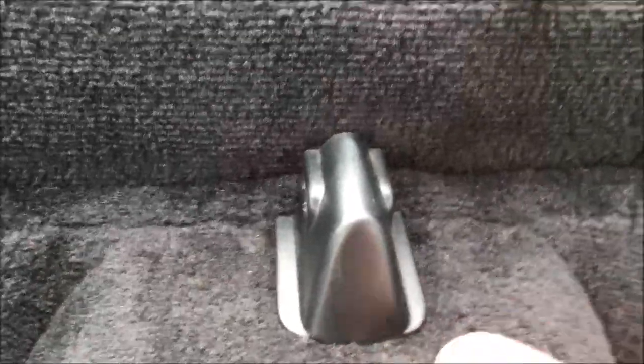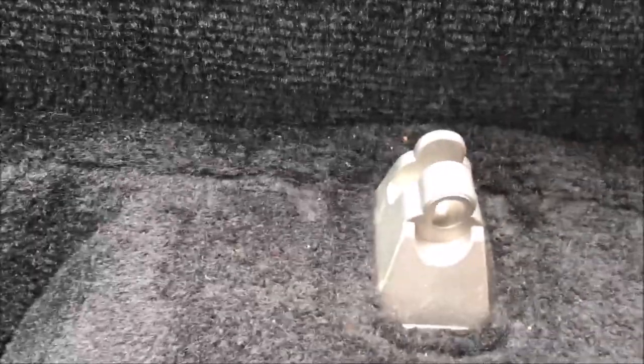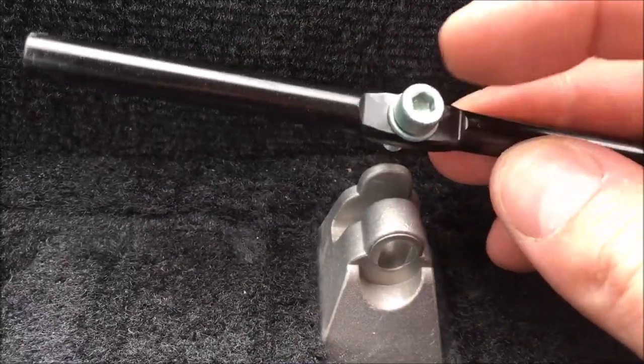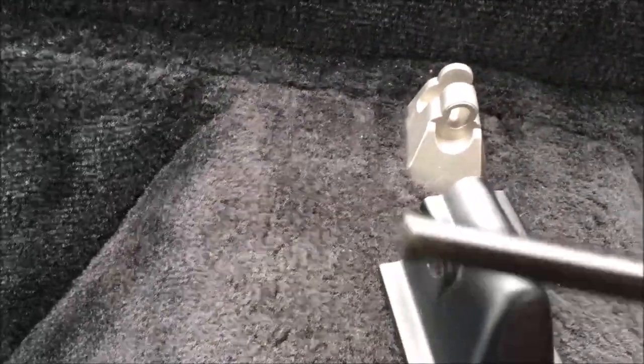I've read online that all you need to do is ping the seat upwards and then out — but if you ping it upwards you break it, and that's exactly what I did. The back of the plastic snaps off, so I've had to order a new one. What you actually need to do is release it forward. The trim panel needs to be released forward because through that hole sits a bar — this is where the 4mm allen bolt comes in. Release this and the seat is free. Either end of this bar goes into the left and right seats — you have to lift the whole thing out as one unit, but once you've got it forward you can pull everything out as the pins are just slotted in.